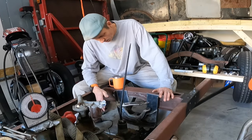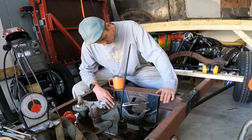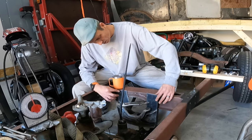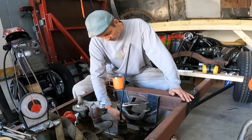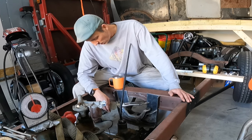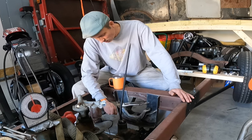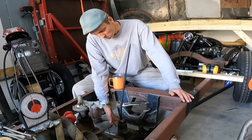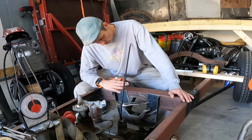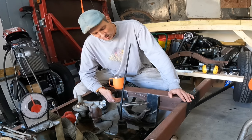We got this tacked together now, clamped into place. I need to cut this little angle off here on both sides so it'll be flat on the top, and I think I'm going to make a piece to go across here and fill in this gap and weld to the top of it. I'm not happy with the looks of it down here, but as long as it gets the engine in the right place I'm fine. I can always come back and cut this here and bring a U-piece around to make it look prettier, and also increase my ground clearance. For now this is going to be what it is - at least to let me get the motor put in and get my front motor mounts figured out.